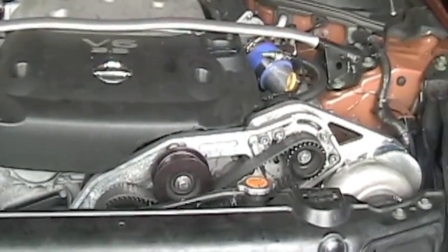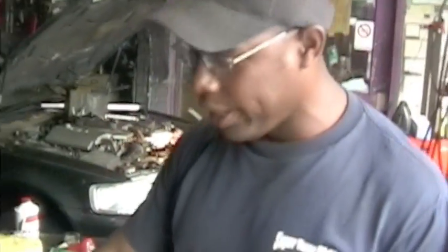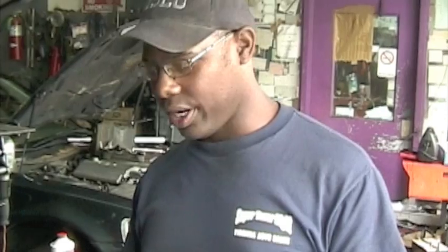We're going to crank it up. Make sure that there's no oil leaks. We already put the oil in. The procharger comes with its own oil. It's self-contained. The most important thing is you have to change the oil. Okay, no, sorry, every 6,000 miles, you have to change the oil, or else you're gonna blow the seals inside the procharger.